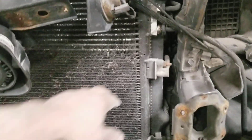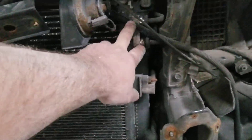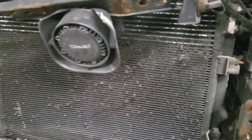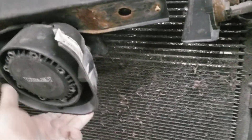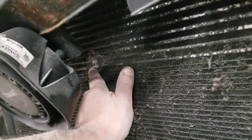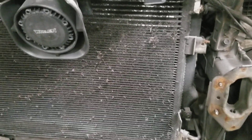I've got to get the transmission leak fixed on the car. On these cars - I know the Fords are the same way, I've had a few of the Taurus and Explorer interceptors apart - the transmission cooler is the same setup. You've got your AC on the bottom and the transmission cooler is actually on top of the AC condenser. That's my assumption - I think that's where it's leaking. The siren came back and it wailed it pretty good back there.